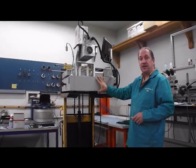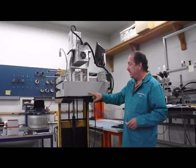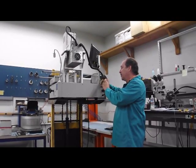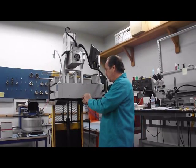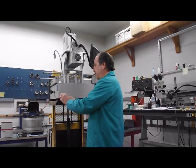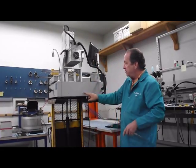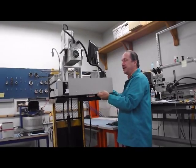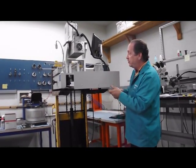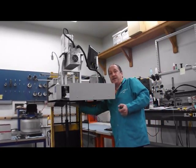First, you want to open up this back drawer — this is actually a drawer that has all your controls in it. There are six screws. You want to take the six outer screws off; you don't want to take these inner screws, these stay on. We have our six screws out, these three upper screws stay in, and this drawer slides out. This is a very simple, very condensed machine — not a lot of parts — and everything is modular inside this drawer. With the drawer open, that's going to allow us to access inside to the heater unit, and we'll pull our bottom panel off and slide it out through there.